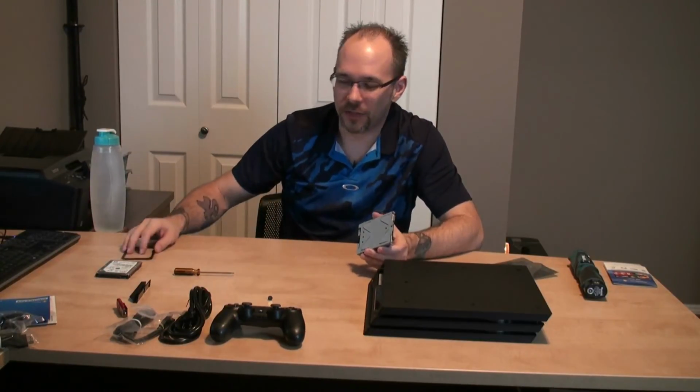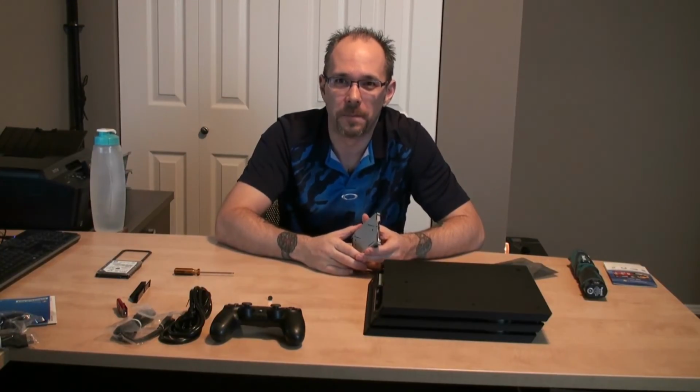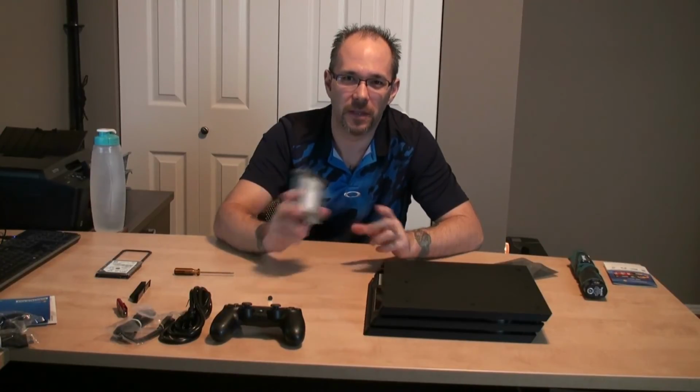That's just the 3-4 games that have been tested. A prime example is the Xbox One S. They do something a little bit different. You're actually able to have an external hard drive, and in that external hard drive enclosure, you put a solid state drive, and you can install 100% of your games externally, because USB 3 is actually just as fast, if not faster, than SATA 3 in some cases.